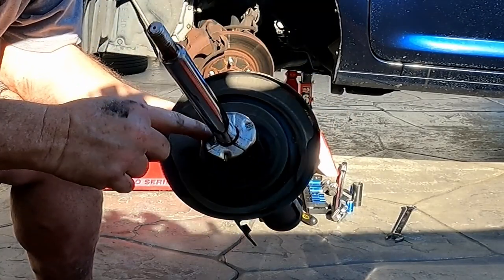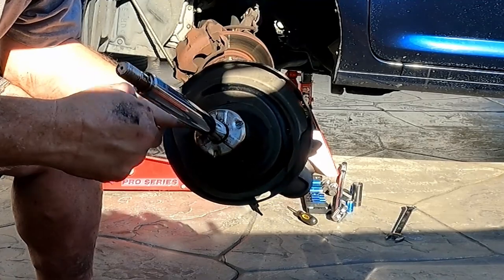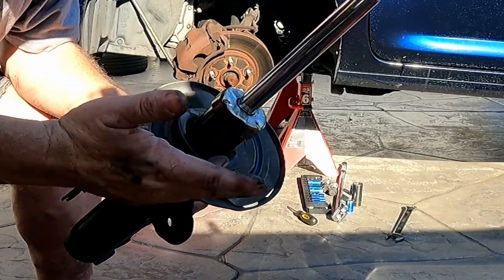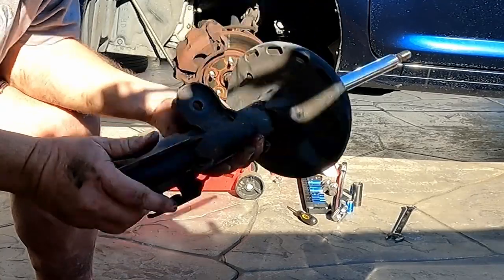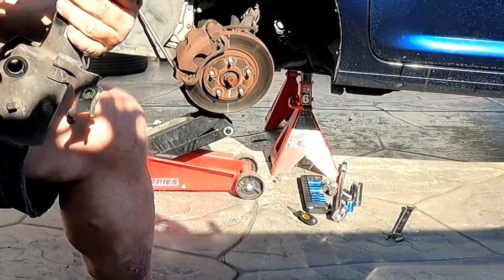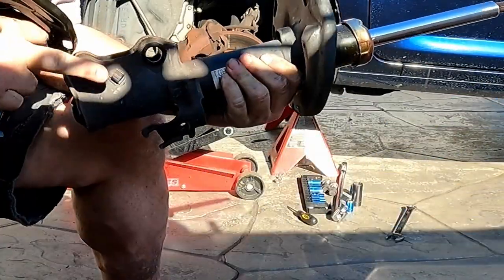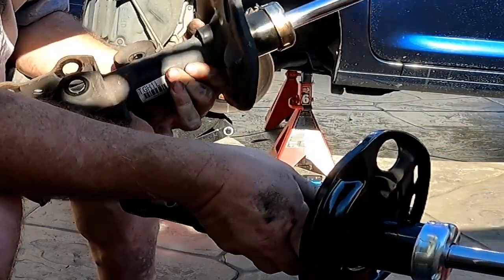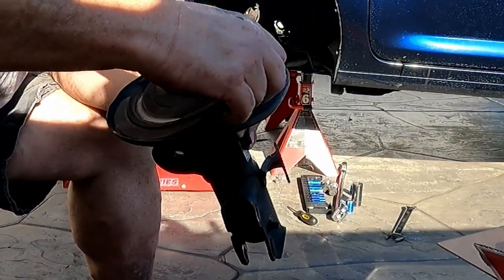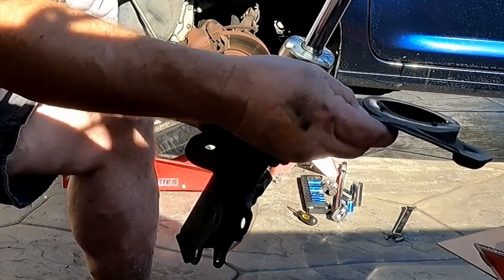There's the old strut — you can see where there's a little bit of moisture around here, so the pressure was leaking by. There's a little bit of grease there so the hydraulic oil inside is getting out. Other than that it looks like it's in good shape, but we've got the new ones to go in its place. Good idea to compare them — make sure they're the same, which they are. We'll just have to change this clip over, and there's another dust cover where the spring sits on that kind of eliminates noise on the perch. We'll put that one on the new one as well.